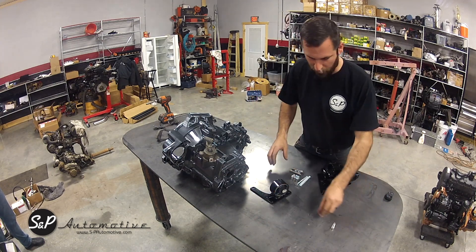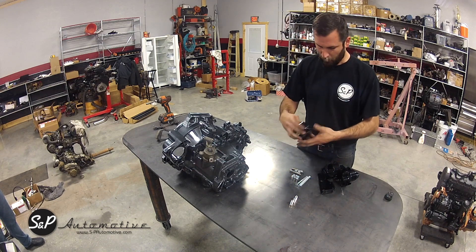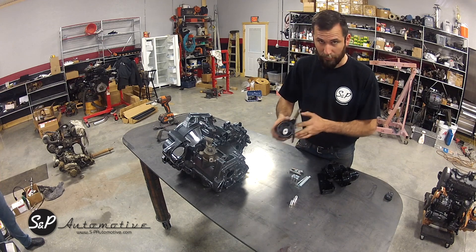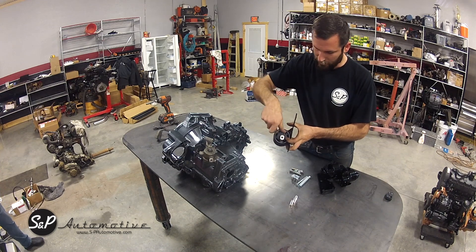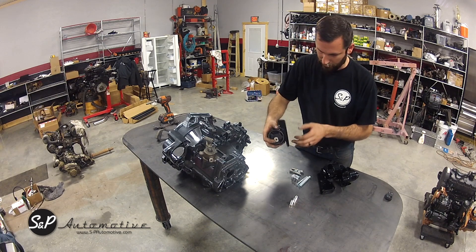These will be coming with the Mark 1 and the Mark 4 integration kit. We've already pressed this mount in — you can order it that way — but this is the direction you want your rubber mounts to be facing. If it's poly, you want to turn this 180 degrees so that you have less rubber above centerline.